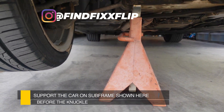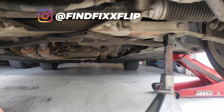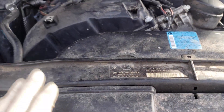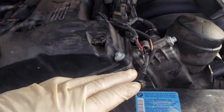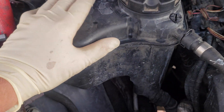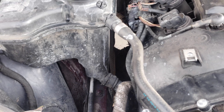How I have the car supported — it's resting on the subframe on both sides, and I have the jack for extra support. Now it's safe to get underneath. We're going to remove the engine cover up top, and that will let us get to the fan. We got to pull the fan, pull the overflow tank, and then we'll get underneath and do a couple things also.